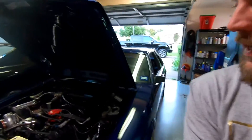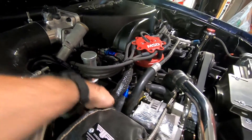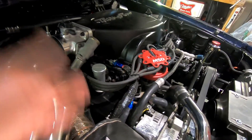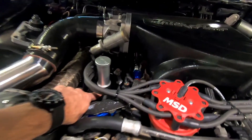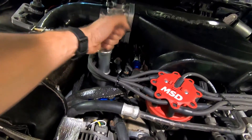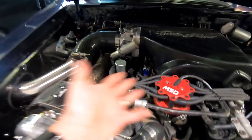We're putting electric dumps on it, which is kind of cool because I don't like crawling under it. I also fixed the oil leak. On previous videos I had a pretty significant blow-by because of the gasket seal around the oil filler neck — it was leaking pretty bad and I was really concerned about it. Every time I'd run the car, I'd open the hood and wipe off all the oil. Obviously don't want the car to catch fire. So I went out and got a new seal — a standard valve cover grommet from O'Reilly's that was the same size. It fits perfect now, it's super tight, doesn't wobble, and it no longer leaks.